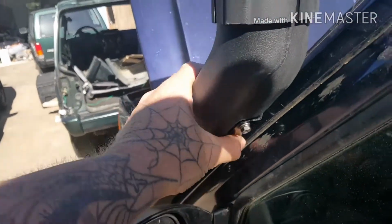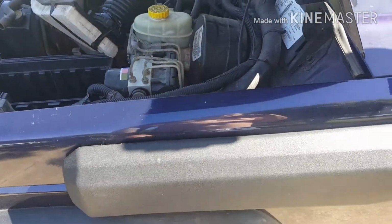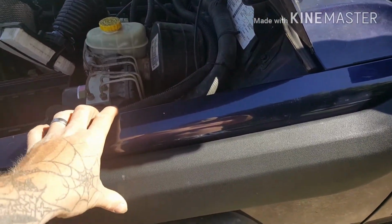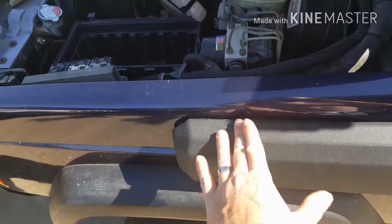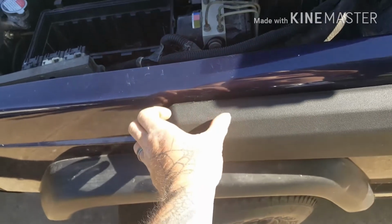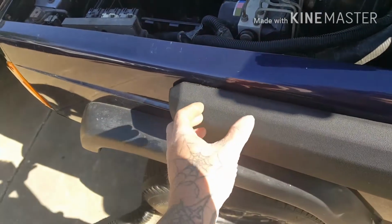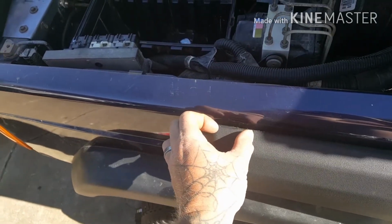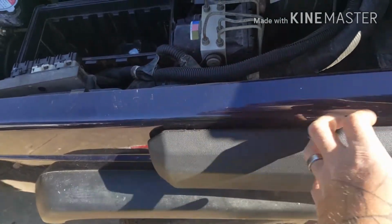You do, however, have to measure really well. I did very meticulously. I used the graph, or the template they had, and it was a pain in the butt. But just make sure you take your time. I put a 3-inch hole inside here. I would recommend making it a little bigger, maybe an extra 1/16 of an inch bigger, or a little more if you've got enough play. If you know for sure your measurements are good, mock it up, put it through there.